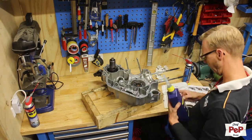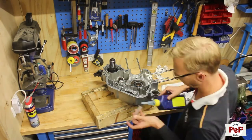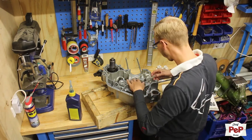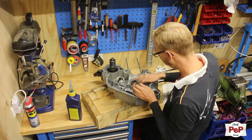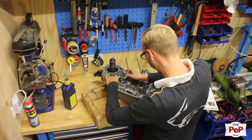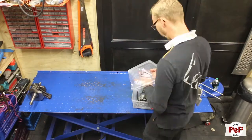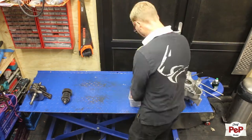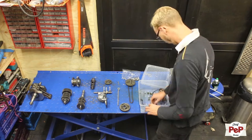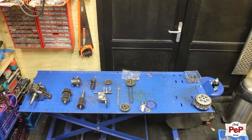I always have a really handy syringe in my garage which I fill with engine oil to oil every bearing very precisely. You want all the bearings or moving or sliding parts to be well oiled before putting everything together, especially when you cleaned them with brake cleaner as I just did. It's been a while since I disassembled the engine so I got all my boxes out and laid down all the inner parts on my motor lift to have a good overview of what needs to be installed.